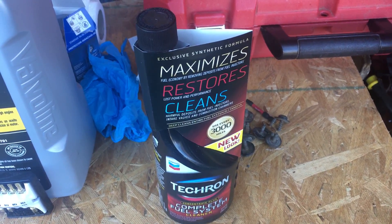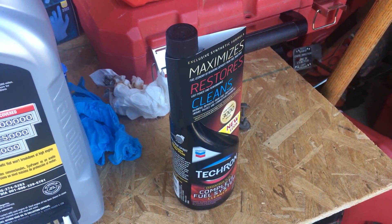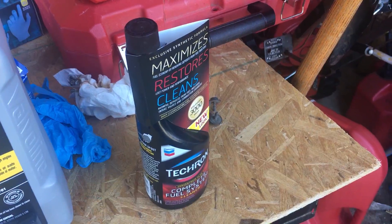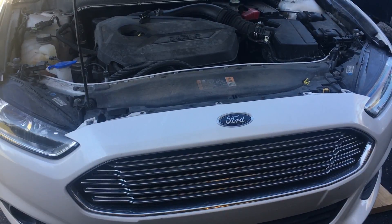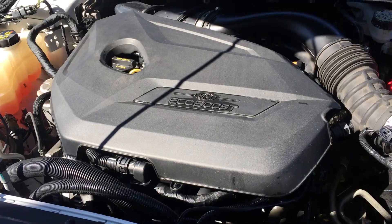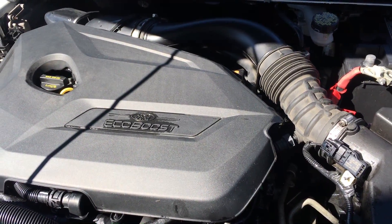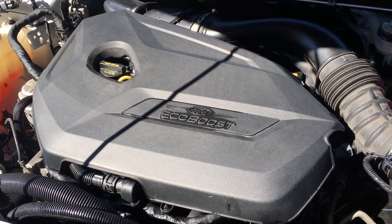It's the low pressure fuel sensor, but I haven't had to replace that yet. At 74,000 miles we were getting some stalling last weekend. I did a little research and it sounds like a low pressure fuel pressure sensor.